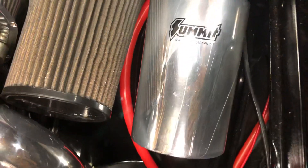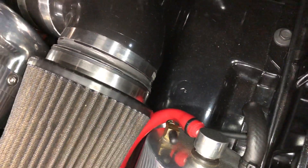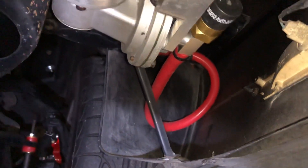The hookup is simple. This is your vacuum line which normally would go back to the back of your carburetor — you don't put it there anymore. I use a vacuum canister; it does help for stop-and-go traffic, not necessary but it really does help — stores up the vacuum going into the brake booster. This line here is going into the electric pump, which I have under the car. It's two wires, plus and minus — that's it.